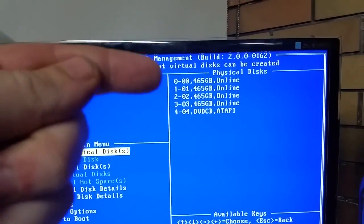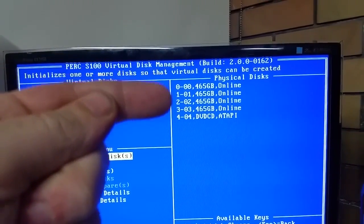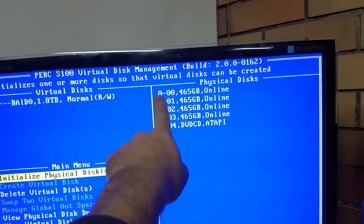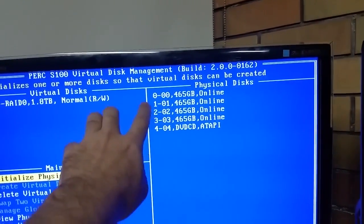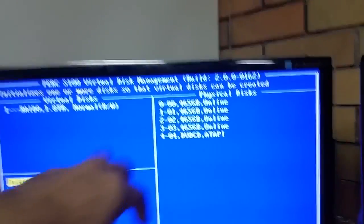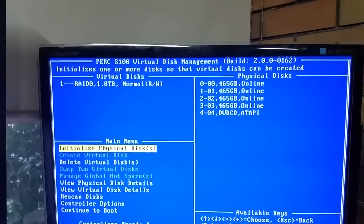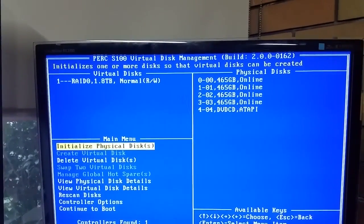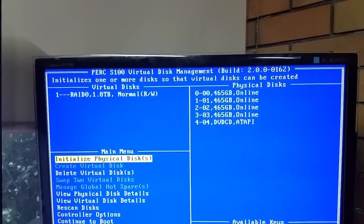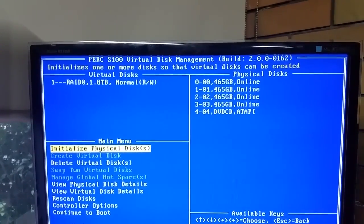In the case of this system, these four drives — I will either put them into RAID 1 with a global hot spare, or RAID 5. But should drive zero fall over, it's quite likely the other three drives will not pick up, because it is kernel-level RAID. Essentially it's virtualized — not virtualized as in virtual operating systems, it's a para-virtualized RAID emulation. That's the PERC S100 virtual disk management system.